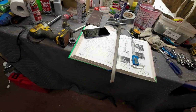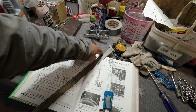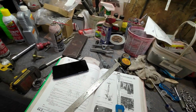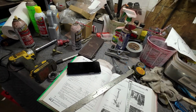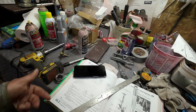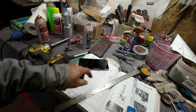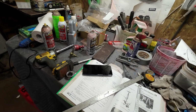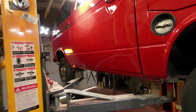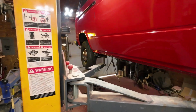Oh, I had it right all the time, and I was just doing the math wrong, because I was taking this like a 38. The tires are 15 inch or 38 centimeters, right? So I was taking 10 millimeters divided by 38 millimeters, and then the arc tangent of that, which gives you the degrees. But it's 380 millimeters: 10 divided by 380, arc tangent, and that gives you 1.5 degrees, which is the answer that I've been looking at all the time. Oh dear, and that had me going around in circles. But anyway, I'm happy with it now. It's right. I only accidentally have it right.